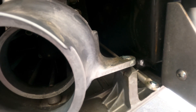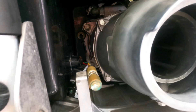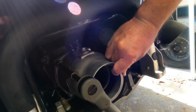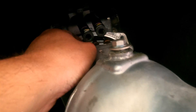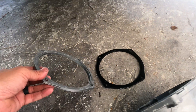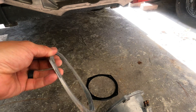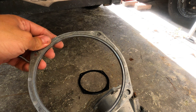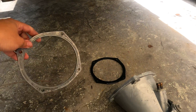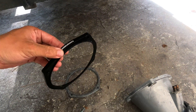We've got our 10-millimeter steering linkage bolt removed. Now we're going to remove these four 12-millimeter bolts holding the exit nozzle in place. Here's a look at our stock pump wedge alongside the two wedges together. The stock wedge looks almost identical to the Kawi Performance wedge. I've been told the stock wedge is a two-degree wedge, and we have this additional two-degree wedge from Kawi Performance, so we're going to double these up.